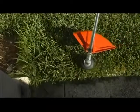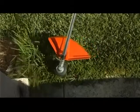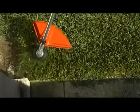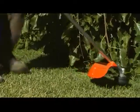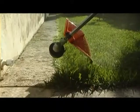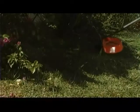There is a knife on the cutting equipment guard that adjusts the line to the appropriate length if too much cord is fed. It is the end of the line that does the work. For efficient grass cutting, the cord length should be close to the maximum length. You also need a high rotational speed on the trimmer head.